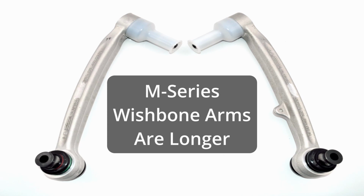It is actually the wishbone, the smaller of the two arms, that is longer on the M series cars. It is not the tension arms that are longer. The longer wishbone arms is what gives the M series vehicles just a little bit more camber.